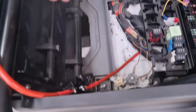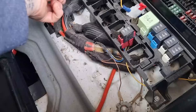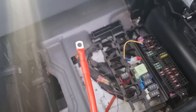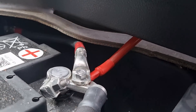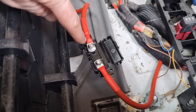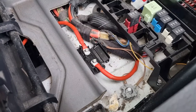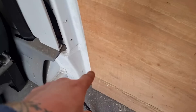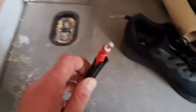We've got the cable passed straight through towards the fuse box. We've got a 60 amp fuse and we've not actually put it in the fuse housing yet, but we've connected it - we'll mount that housing somewhere on the fuse panel to keep it safe. This side connects to the battery, connected underneath the main terminal. That now means this side is completely live - when it comes around to actually connecting it I'll put the fuse in and that'll make the whole system live.